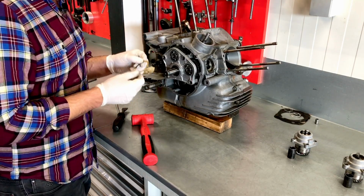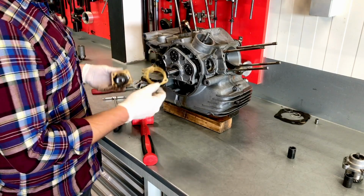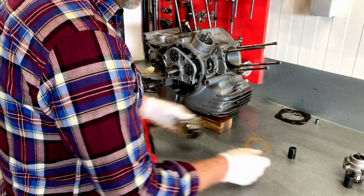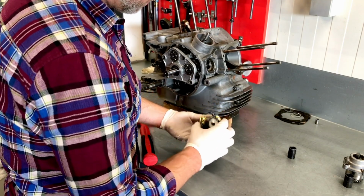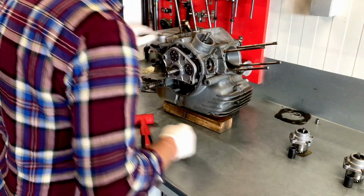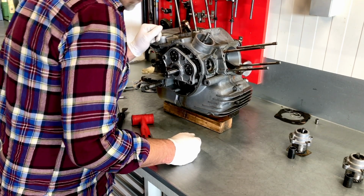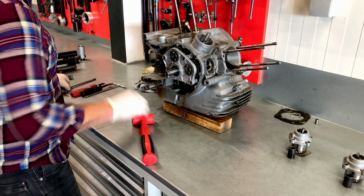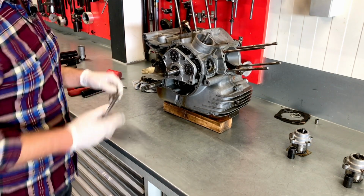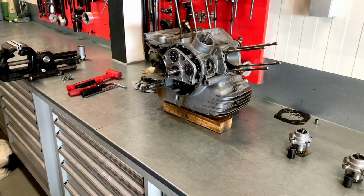These brass plates are used to get the height correct, so it sort of acts as a shim. And we always keep them together. You see there is already one on here as well, in order to reassemble it later on, shimmed correctly. Presuming that it is shimmed correctly right now, but we'll check it and redo that later on anyway.